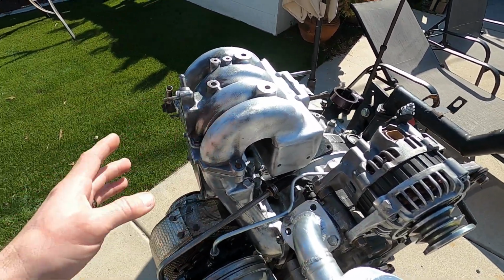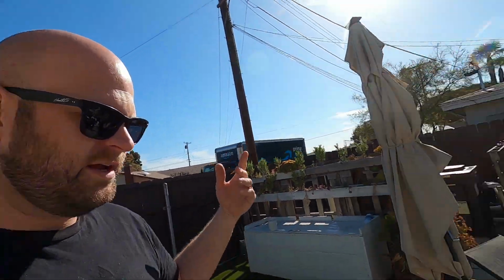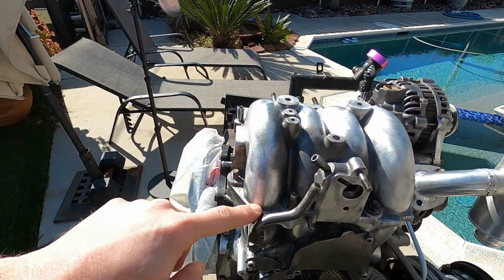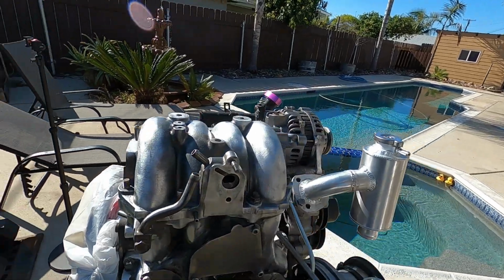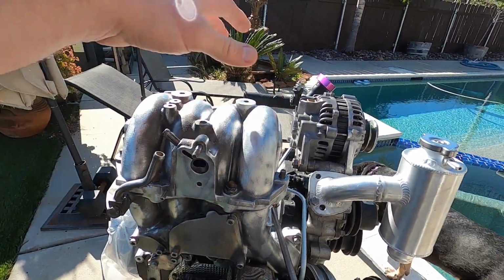These manifolds were the hardest to polish. They were the most greased up, and previously I had put clear coat on them, but that got burnt basically, and everything got seated in there, so I used paint stripper, degreaser, brake cleaner, and ultimately wire wheeled it. And still you can see in places it's not super clean, but overall, this car is going to be driven, so I can't waste too much time on that because it is going to get dirty again. But that's cleaned up.